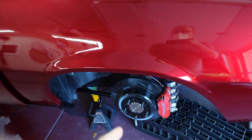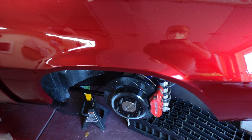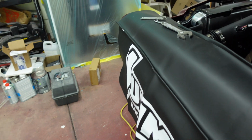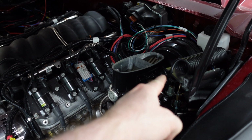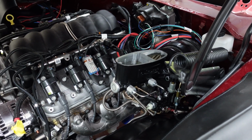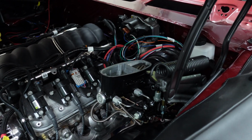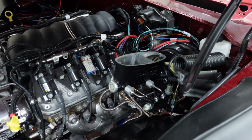So we'll make this one to where it drags a little bit, and then the other one so it drags a little bit more, and then hopefully when you release the brake, both shoes are not making contact with the hubs there. And then on the bleeding side, as Pops was just talking about, I want to probably pop the master cylinder off and just make sure I put that push rod in there and that it's the right length. I'm pretty sure it's all in there because there's some pedal feel. It's not like there's none. But the fact that we mash on the brake pedal and we don't see any bubbles coming up here, I don't see anything coming out of the calipers, is a little odd. So we'll probably check that, and hopefully we can do that without draining it, because I have to start all over if we do that.